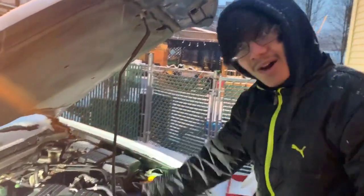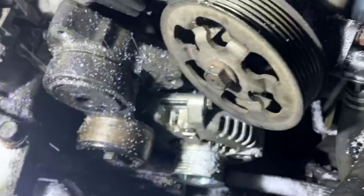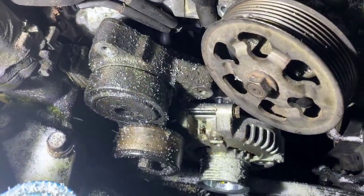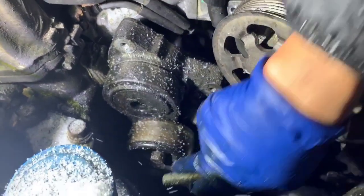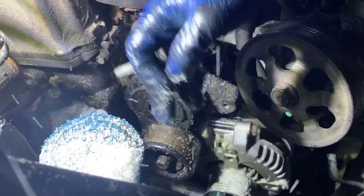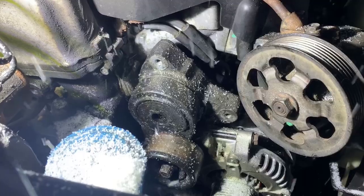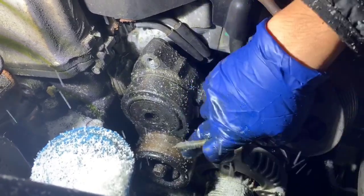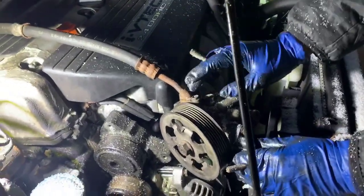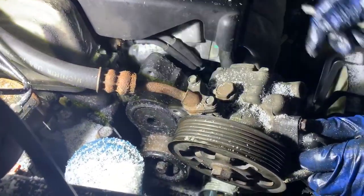As you saw, our Milwaukee got stuck while we were trying to screw this in. Word to the wise: the torque specification for the center pulley bolt is supposed to be 41 foot pounds, but because this is the tensioner, when we pull it back to put the serpentine belt on it's going to torque itself — so we don't have to worry about it right now. Instead, we're going to put the power steering pump back on, which is pretty easy — we just realign it.